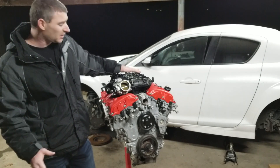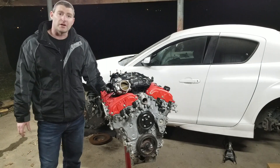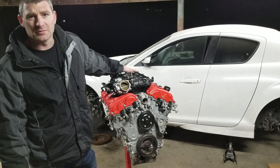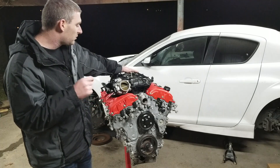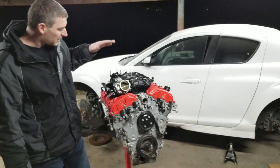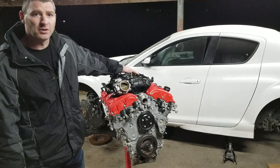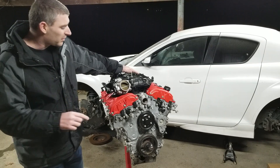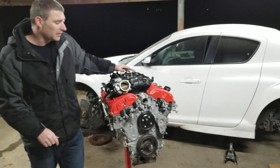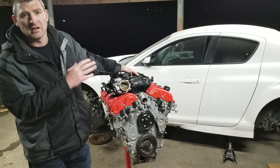If you're just going to make a custom swap into something, you can absolutely keep the front wheel drive components — it's not going to prevent you from bolting up a rear wheel drive transmission to this engine. You will need to reroute some cooling hoses, but that's going to be custom in an engine swap anyway. You do need to know there are horsepower differences: basically the intake manifold, the exhaust — which is a little more choked in a front wheel drive application — and possibly some tuning. Usually the front wheel drive engines have less power. The engine itself is exactly the same, so if you swap over the intake manifold, put on a good exhaust, and have some kind of tune or use a Camaro ECU, you should be able to make the same power that a Camaro makes from the factory.